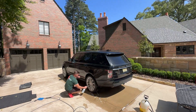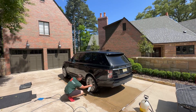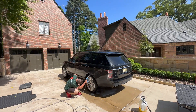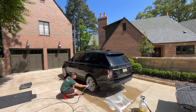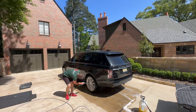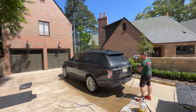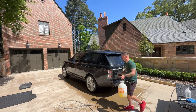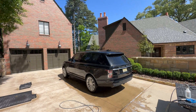I was just showing you a little sprayer that I have made. When I go around the vehicles, that little sprayer has pressurized air in it and it stays pressurized throughout the whole process — for wheel cleaning, bug cleaning. It's a two-gallon sprayer. It breaks down the dirt and stuff on the wheels. I should probably do a video on that, because those little trigger sprayer bottles that typical places use, your hands can get very tired from constantly pushing it. As you can see I'm spraying on these mats — boom, boom — it's real quick, it stays pressurized throughout the whole entire process.